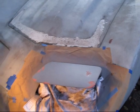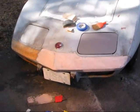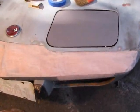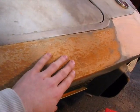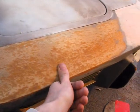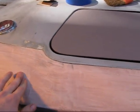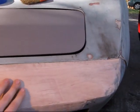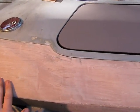I've been starting a little bit of body work here on the nose of the Vette. This rubber bumper is really gnarled up from the sun and age — it's really pitted — but it looks a little better now because I sanded it with some 60 grit and knocked down some of the nibs. Over here I've been smearing a little bit of Bondo. Since the rubber bumper does flex, I don't want to put it on too thick or the Bondo will probably just crack off, so I just skimmed a little bit on there mostly to get rid of the pitting.